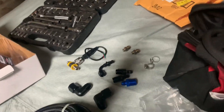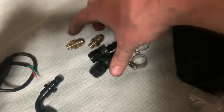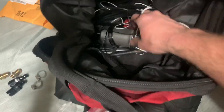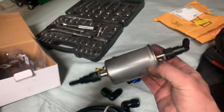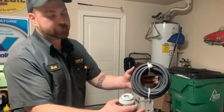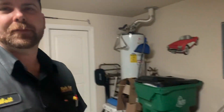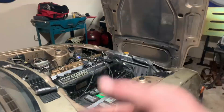We got all the old hose and fuel filter out. Now we got our AN fittings — these come off the cell, these are for the pump, and these are for the rail. We matched up a fuel filter with three-eighths fittings at the shop with quick connect fittings. Look at this PTFE hose — it's really hard and firm, probably going to be a huge pain to work with. Sliding one of those barbs into the hose is really difficult, but since this is E85 approved, hopefully we'll only have to do it once.